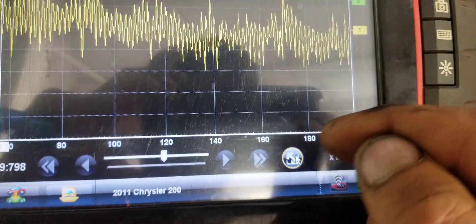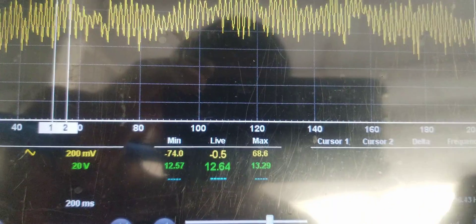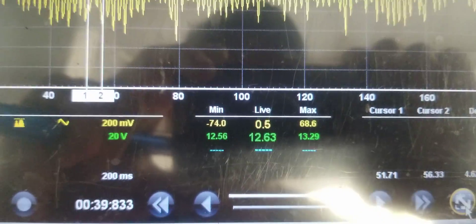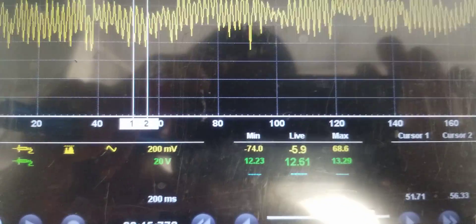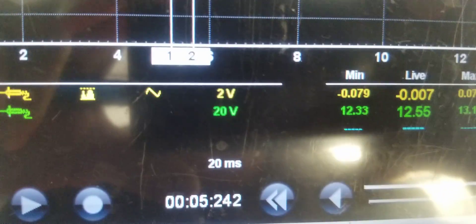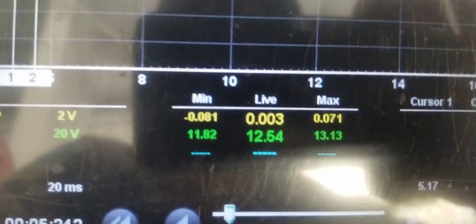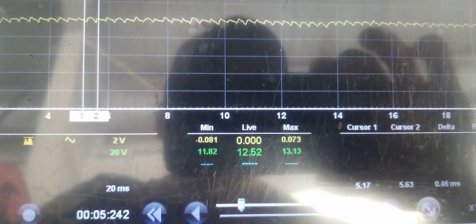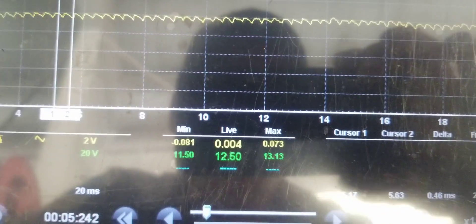Considerably different than before. I'm going to show you this voltage — you can see it's going down. I haven't got an assistant in there yet to raise the RPMs to check it. We're still on a 200 millivolt, 200 millisecond screen. Let me go back out to a 2 volt screen and see what it looks like. Here's the ripple on a 2 volt screen, 20 milliseconds, and you can see it looks nice and clean. Battery voltage is going down below 12.6, but we're fully loaded and I'm not raising the RPMs. Napa brand — I'm a little concerned, but I didn't make that call.